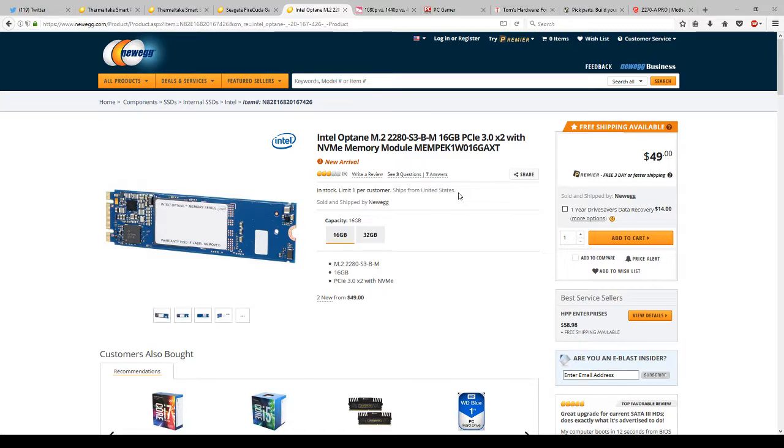One of the many things that I have noticed with other consultants is that they'll build a PC for themselves using air cooling. The PC will be too hot and they'll just basically say it sucks, never touched again. When it comes to that particular scenario, I have noticed the reason for it is because they select a low CFM fan.